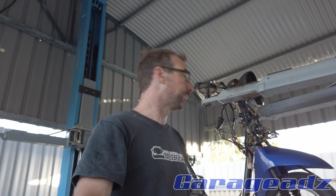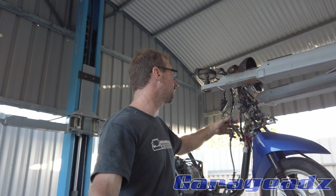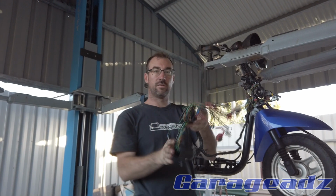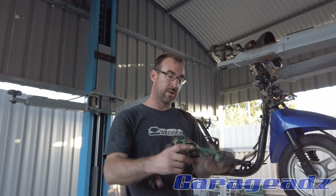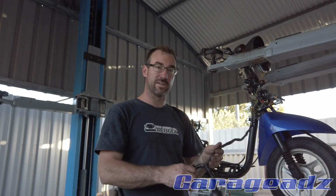Alright, so wiring is not as hard as people think. People think it's hard, so they make it hard for themselves. I used to be scared of wiring, and I used to go, oh my god, no wires, they're all different colors and it looks like spaghetti and now it makes me hungry. But you do one wire at a time and you can't really go wrong. So what I've got to do is pull all this wiring off and basically extract out of this harness what I need to operate the Honda as far as the lights and the indicators and everything goes, and the connection to the battery, and all the rest just doesn't need to be there.